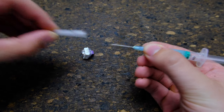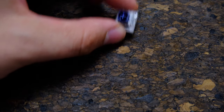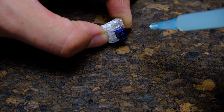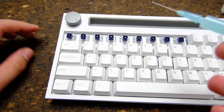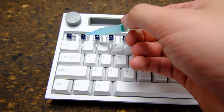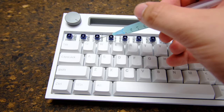This is where our little syringe comes into play, because of capillary action - which is basically a liquid sucking itself where it shouldn't be. All you have to do is take the pointy bit and stick it into the side like so. So you take your switch, take your syringe and put it onto the side, press it and get a little drop, and once you make that little droplet big enough it will actually spread to the side of the switch, at which point it will basically just suck itself inside. With the switches in your keyboard it's the exact same procedure - you just stick the side of your syringe in a bit, create a drop, and then the drop will go inside all on its own.